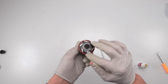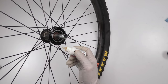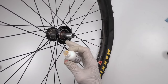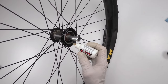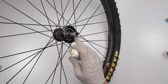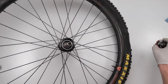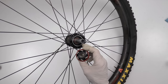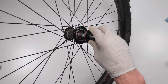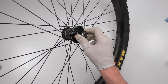Put a little bit of oil on each one of the pawls. More importantly, put oil on the edge around the rim. Now we need to put oil onto the wheel — the more oil you put, the quieter the wheel gets, but these are very loud hubs. You can't put too much oil or the Torch will spin on you. Fill it up to about a 45-degree angle without spilling over. Take the hub, notice the notches — those allow the pawls to fit in. Slowly put it on top, turn counterclockwise until it sinks in.